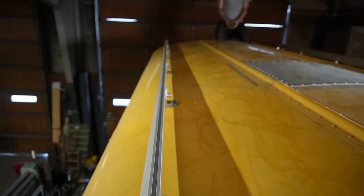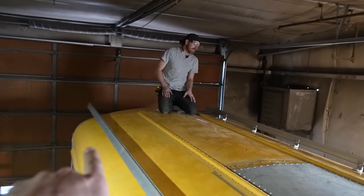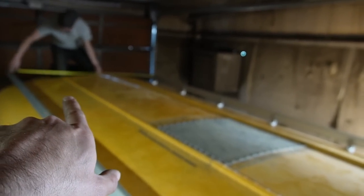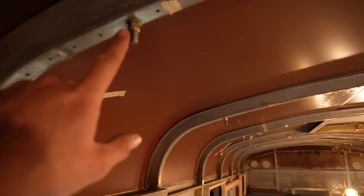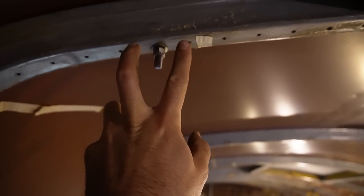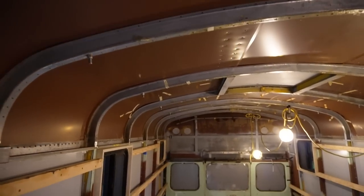I may or may not leave the rail on here and get it painted with the roof. But that turned out nice and straight. Ben just measured our distances to check how parallel we did: 70 and five-sixteenths at the back, and 70 and five-sixteenths at the very front. And a final shot on the inside — you'll notice I've left the framing off on the inside because your bolt will almost inevitably end up right where you want some strapping. I'd rather have my bolts go in and then shift my strapping left and right than have to drill a hole there.